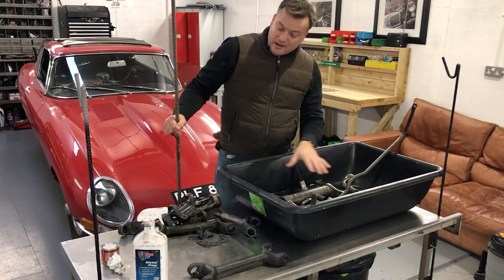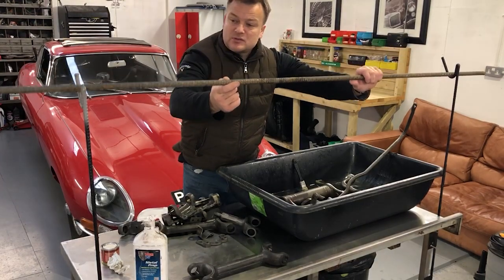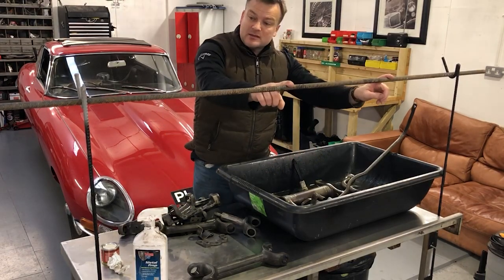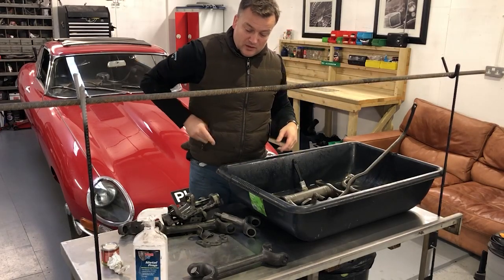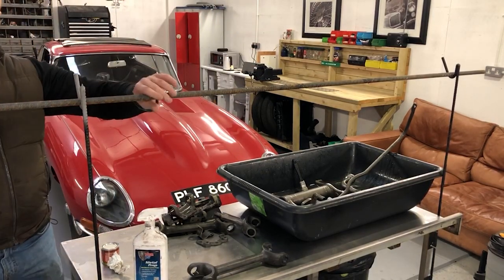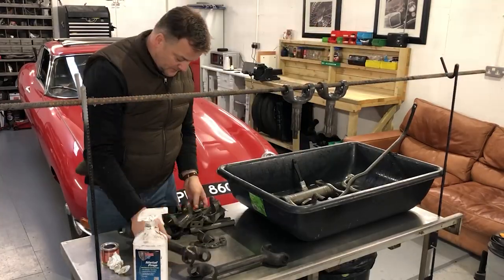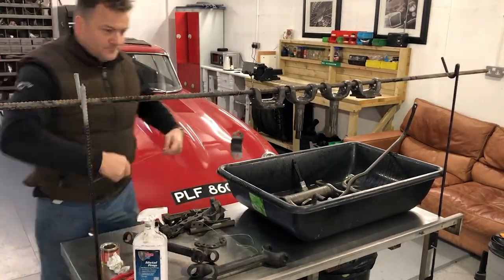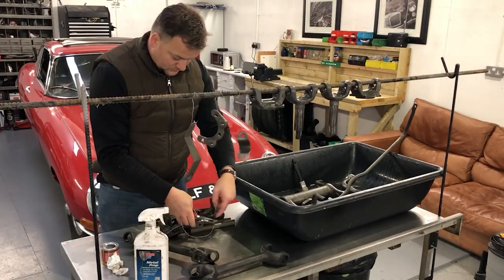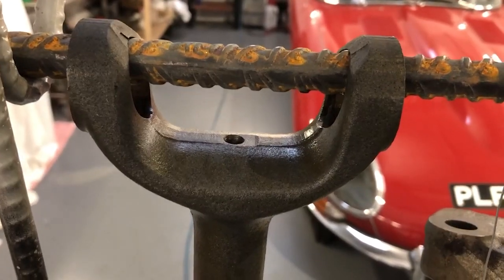I've got the large parts in pickling now. All of these parts I've rinsed off ready to dry. I've modified my workbench to give me a suitable place to hang all of these parts, dry them, and then paint them afterwards — that should make my life a lot easier. I'm hoping that this bit of steel rebar here, propped up in this way, will be a good height and position to be able to hook everything onto. As I dry these out, it shows quite clearly where there's a kind of slightly white etched surface.